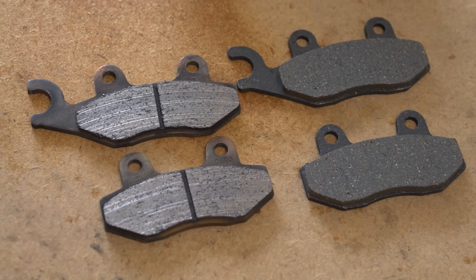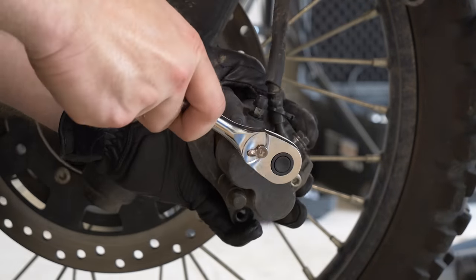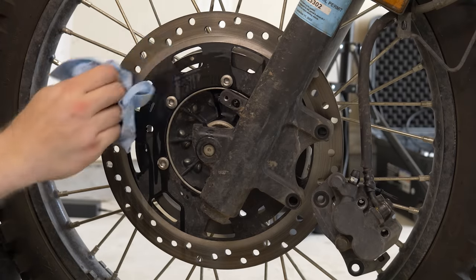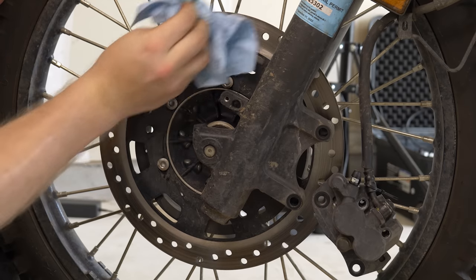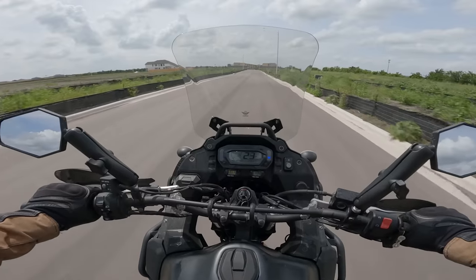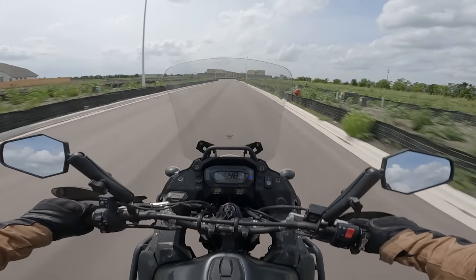A brake pad swap is a bit more involved. On fancy bikes you don't have to take the caliper off, but on the KLR650 you need to pull the whole caliper, then pull a pair of pins, and reinstall the new pads. Thankfully there's only one caliper to deal with on this bike, and it's not that tough a job, especially if you're a student of YouTube University. Spraying the rotor with brake cleaner helps get old pad material or debris off and ensures the new pads are biting into clean metal. Finally, the process of bedding down brake pads mates your new pads and old rotors so they work as best they can — you have to brake from slow speeds up to high-speed panic-stop braking and let the pads and rotors cool between stops.